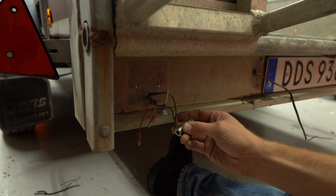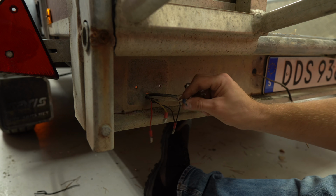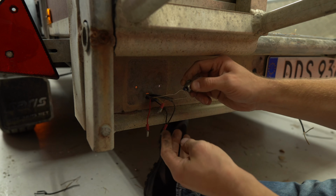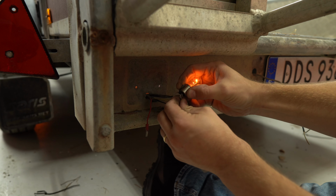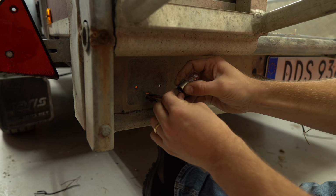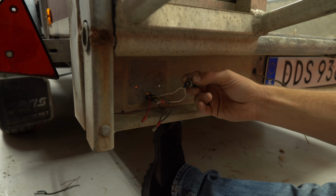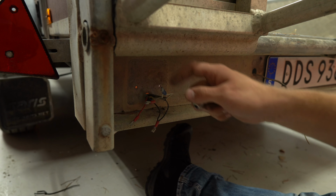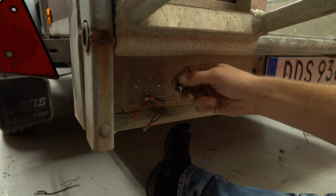Why is that on? Why is the brake light on? Yeah, I think I'm assuming wrong. The white one is probably ground. Tail light, blinkers, and then that should be brake light. That's weird. Alright, well I guess white is used as ground sometimes. That's just a little odd. I was betting the black one was ground, but okay, that's fine.